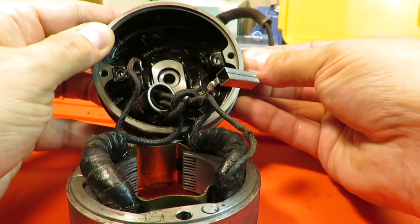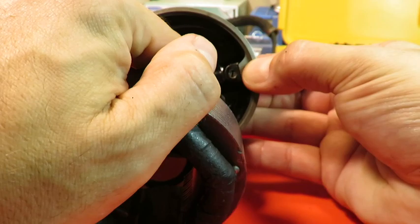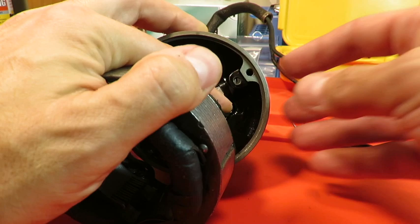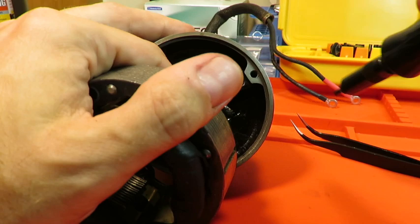He's a little tighter. And get this. It's going to be possibly hard for you to see, but get this holder in there, like that. And then I'm going to get them oriented straight and then in just about as far as I found them, so that the flat spot on the Bakelite sheet matches up with that grub screw that's going to hold it in place nicely. And I'm going to call that good.